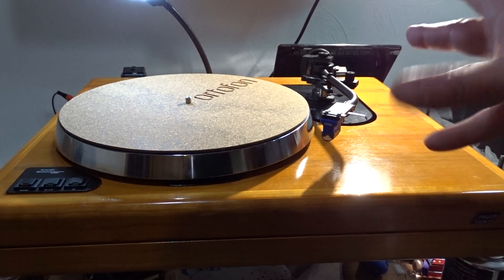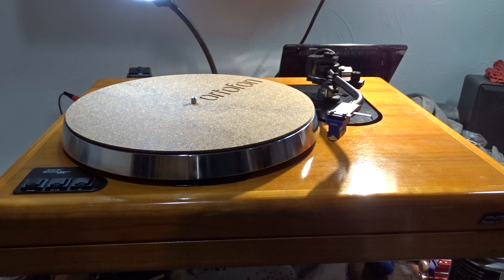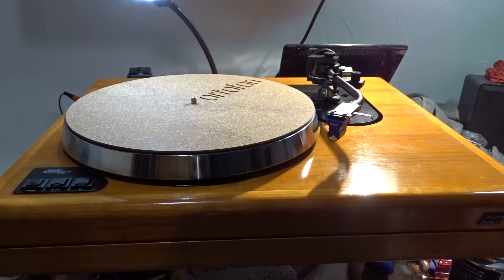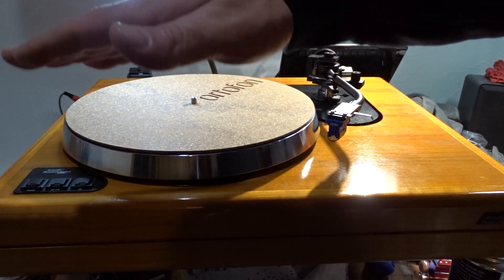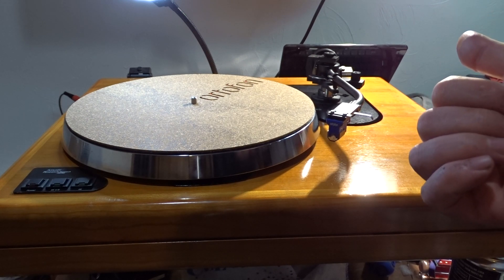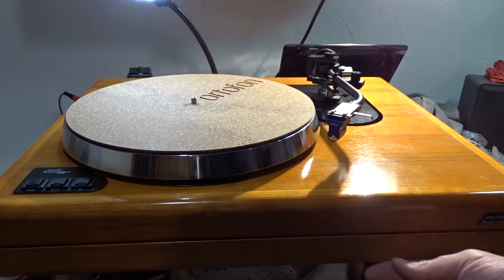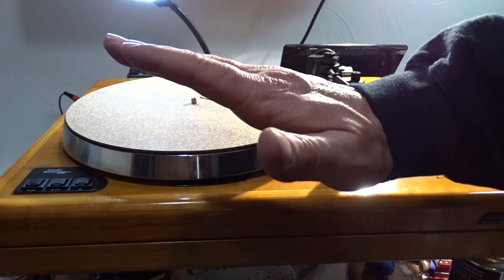It's supposed to bounce straight up and down, and it's supposed to decay over a few moments — I think two or three seconds, something like that. When I first set this up, I leveled the plinth and tuned the suspension as best I could, but I forgot to level the suspension with the plinth. So when I got it over to my media rack, I went to level off the platter with the adjusting feet, and the whole plinth was kicked to the side — the platter was level, but the plinth was cockeyed.